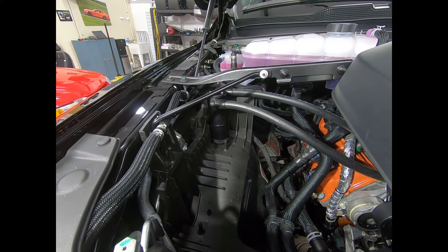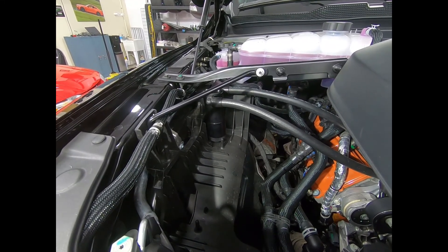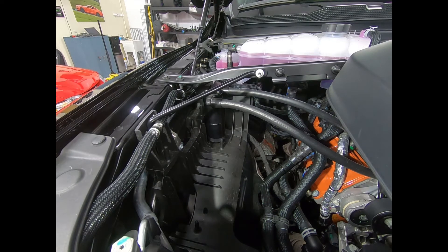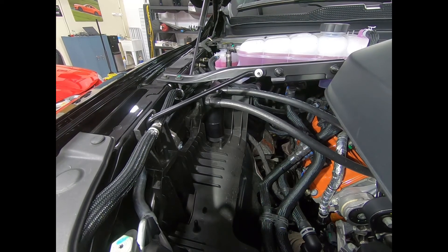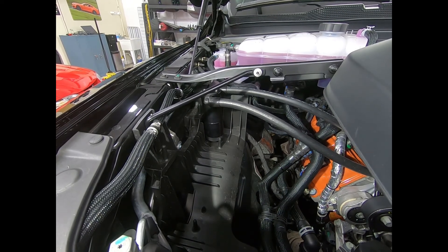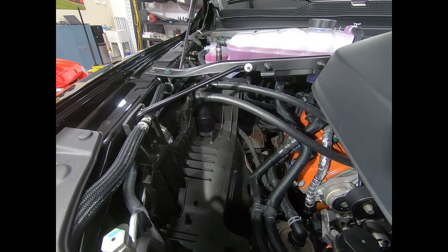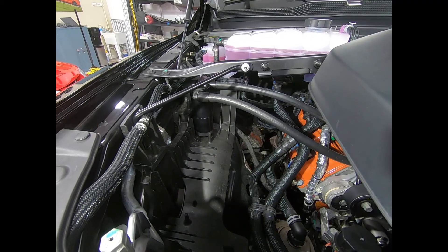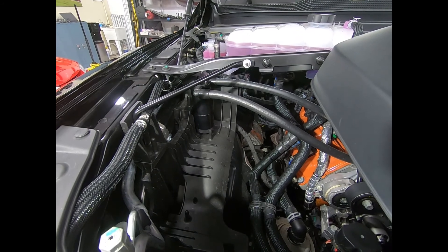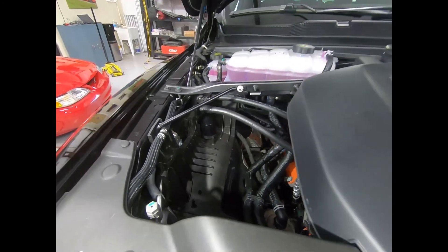This kit is compatible with our extension, which doubles the capacity of the can. Average collection on the Hellcat motors is typically about an ounce every thousand miles. The regular can holds three ounces; with the extension, it holds roughly six. If you live in a cold climate and drive the truck year round, in the winter months you're going to collect more condensation in the can due to temperature difference, so you'll have to service it more frequently — you may want to get the extension just to buy you more time, but it's completely optional. Thanks for watching, stay tuned.